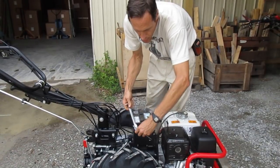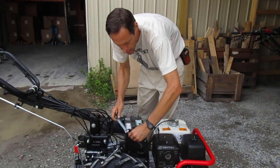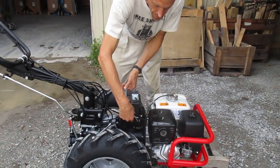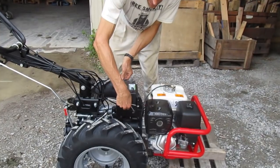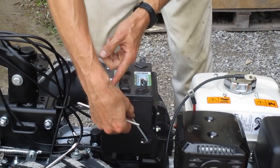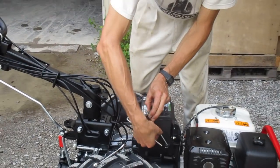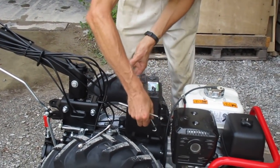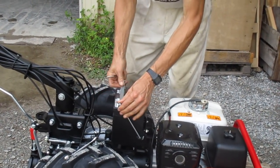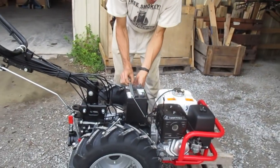Oh yeah, I am doing this wrong because you do have to pull this thing up the other way. When you put these on, you always want to make sure to have these hooks going to this side of those little pull tabs, not this side. The difference is how much bolt is going to be exposed at the top. If you do it the wrong way, you've got more bolt exposed, and when you turn your handlebars around, the shift levers actually hit these bolts. So you've got to pull these things down by hooking them around this side of the pull tab. Glad I did that wrong so you can see what right is.